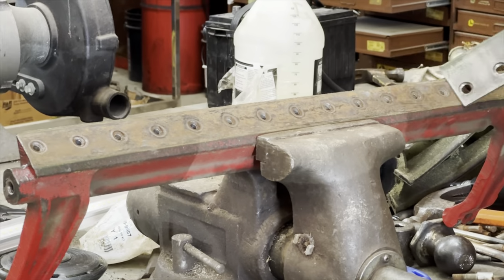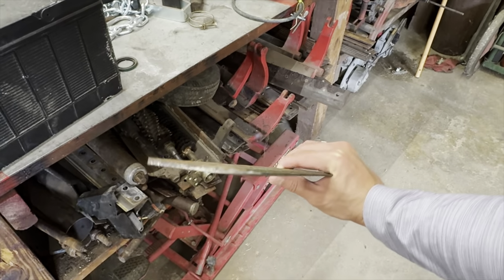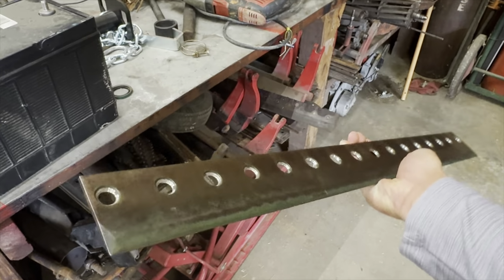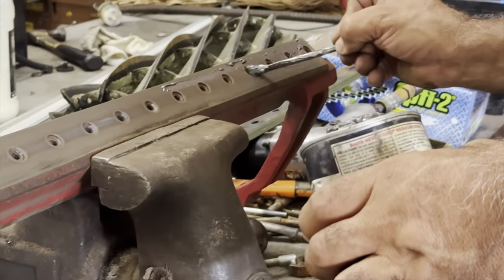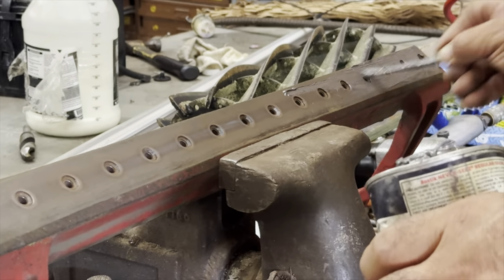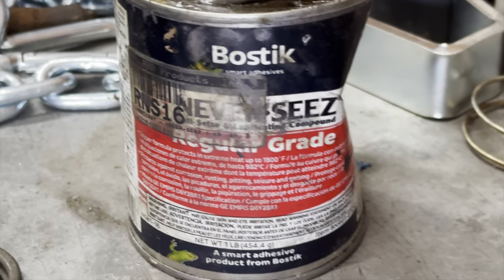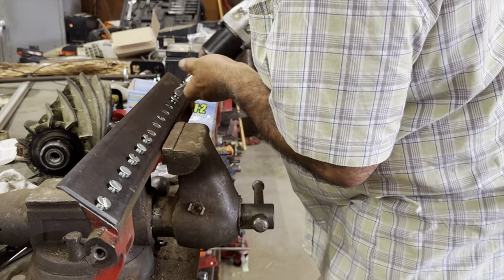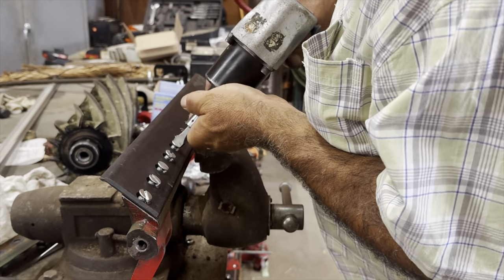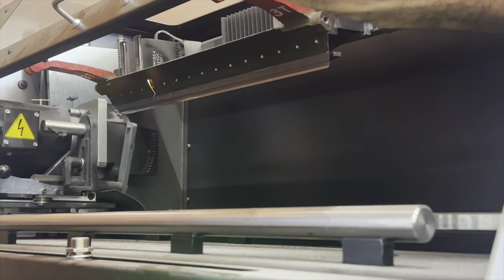Alrighty, what he explained to me was, these bed knives are already ground at 5 degrees, right? It's basically ready to go. It's perfectly flat. They press it on a machine, they don't put it on a bed bar like how it should be when it's on a mower. So the problem is, when you mount the bed knife onto the bed bar, the bar itself is not perfectly flat. It's not perfectly even. So the bed knife is going to follow the bed bar, and that is the reason why it's not going to be perfectly even all the way across. Therefore, you must put it on a machine to grind it to make sure that everything is perfectly even across. That part made sense to me, and now I understand why it's standard practice to grind bed knives when they're put on the bed bar.